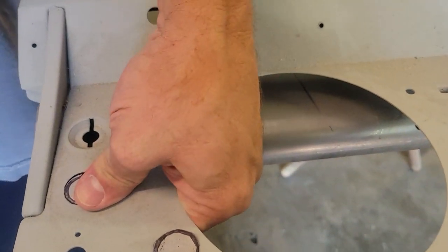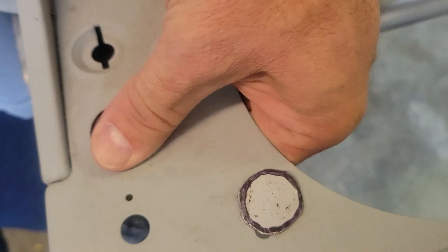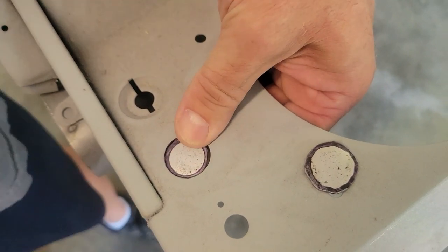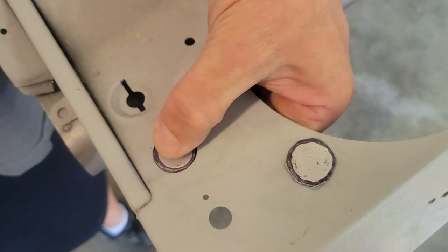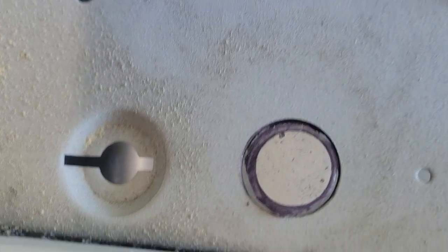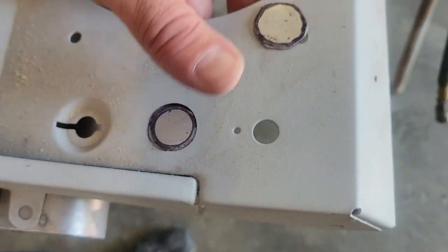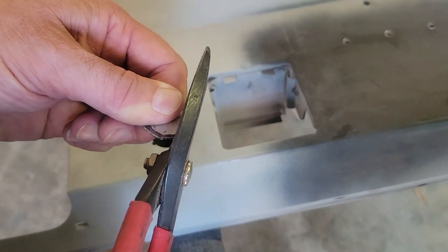This doesn't have to be perfect - actually you want to leave a little bit of gap so your weld can penetrate. Let's see - I think that's going to fit really good. I'll dolly that in with a hammer. It's hard to tell the way Joni's holding the camera but you can actually see through it, see the little cracks. That'll make sure the weld penetrates well. On the old cigarette lighter hole we're doing the same thing - this one was just a little bit big.